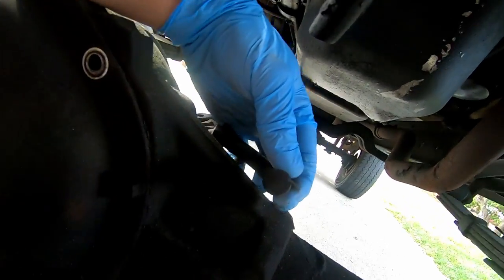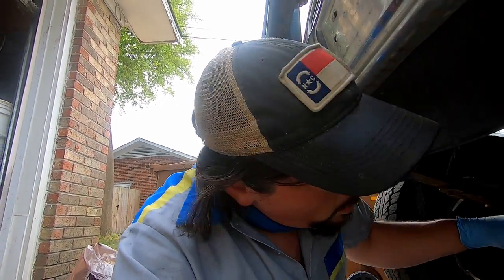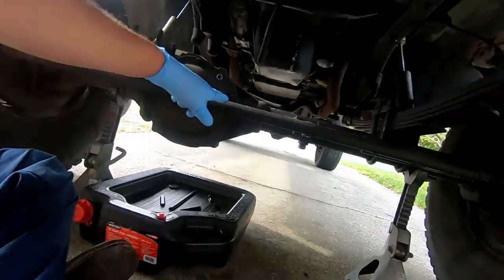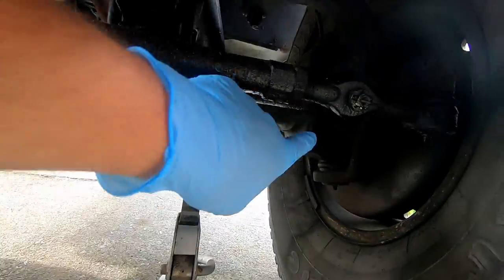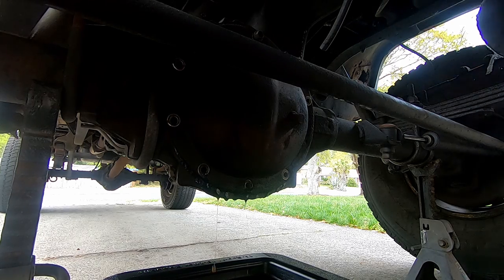Look at the end of it there - first off, that hose is not hooked up, it's been cut. It was like that when I bought the truck. But if you look in there, it looks like a dirt dauber made a real estate investment in that hose. When that vent's plugged up and you're using that differential, as it heats up and expands, that's what that vent is for - and then it cools back down. If you don't have some vent action going on, it blows out the weakest link, which sometimes can be the diff cover, or the seal between the diff cover and the housing, or the inner seals, and then the oil runs out the ends. Before you do any kind of seal replacements on that differential, check the vent.